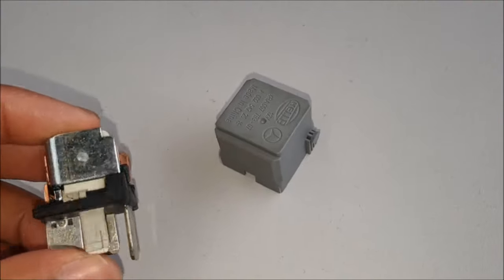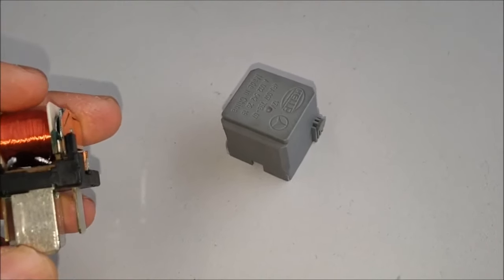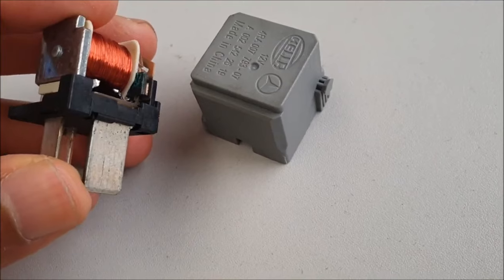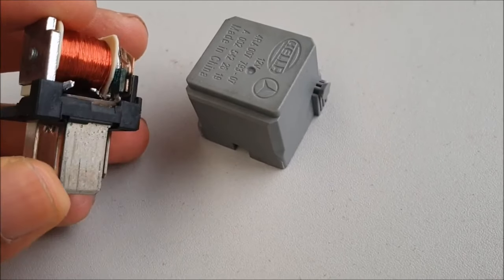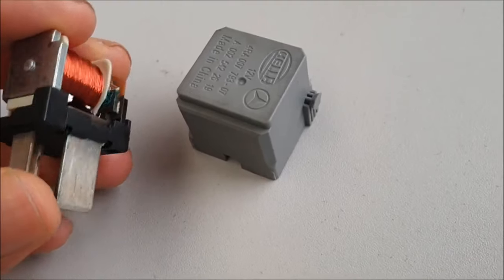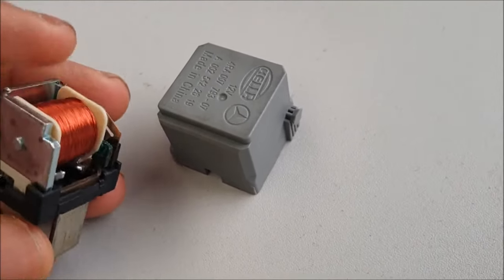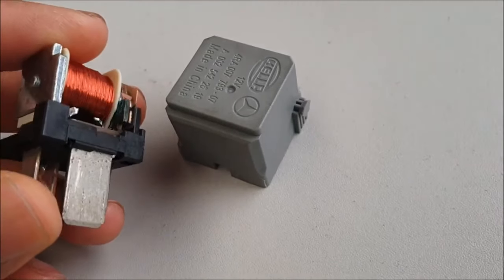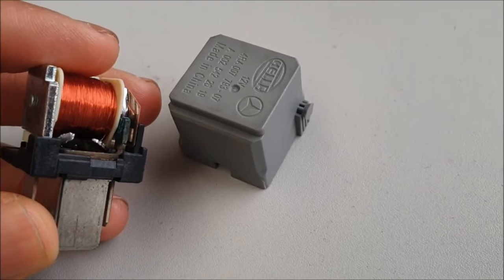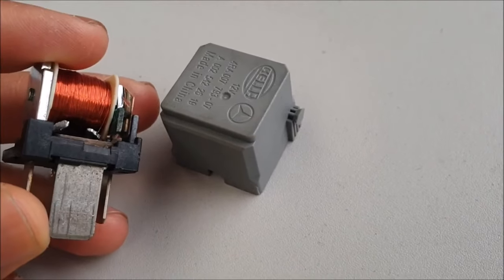And I just thought I'd make this video so it helps anyone else out who also has a similar problem. Up now you'll see the van starting up fine, and it's been starting up fine ever since. So this job was done about 3 months ago and we have not had a single problem with the van ever since. Change these relays and potentially replace the ground cable or give it a good clean, just so you ensure that the problem never comes back.